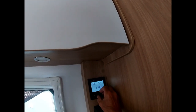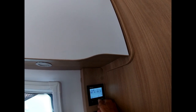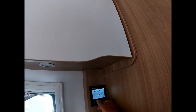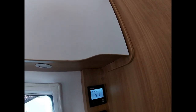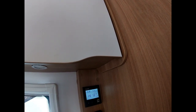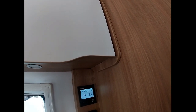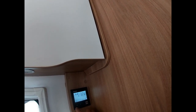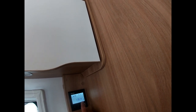And I do that by selecting 13:54, for example, and then I come over to my spanner: temperature, brightness, 12 or 24 hours, language, index, reset. Reset's the one, because if you confuse yourself, if you press reset and then press PR set, you will completely reset and recalibrate the whole system back to factory settings. And then you need to go back in and reprogram it. If you get to a stage where you want to get out, you just press the return key there, and back you come. Okay, so back to the front screen.